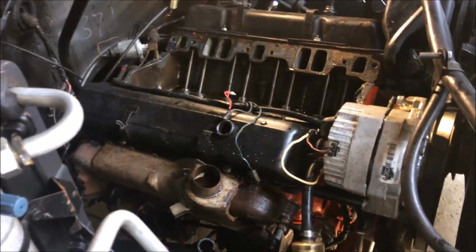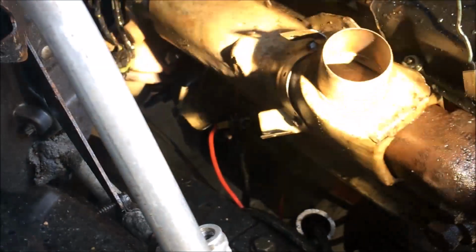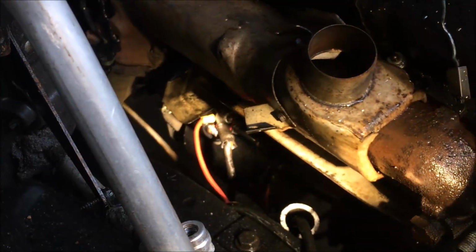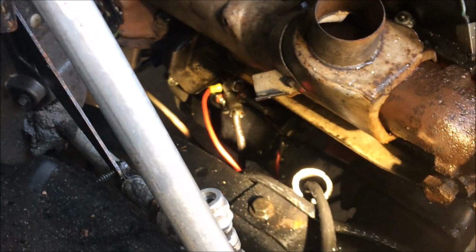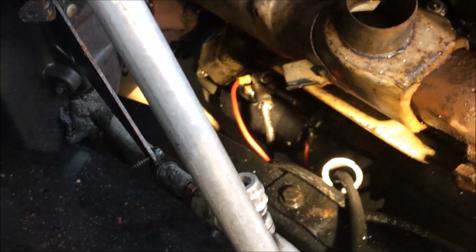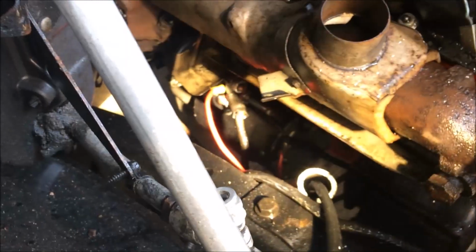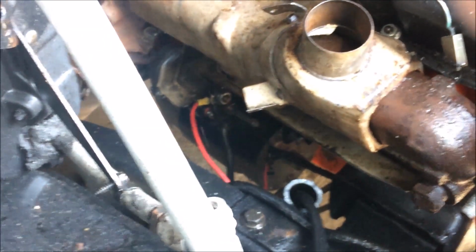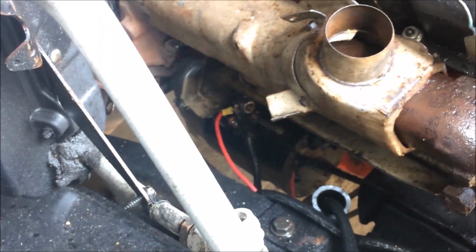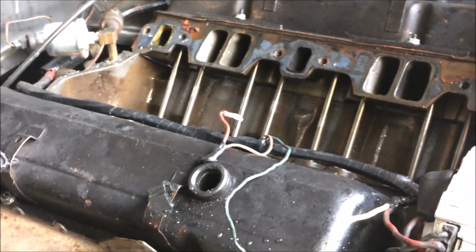And we got to get some wiring for our starter. You may be able to see it down in there. Need the light running. The starter, all the wiring screwed up, which is why it's eating starters. It's part of it. Look at that. I mean, come on, man. And they're electrical taping wires together. Your starter is going to eat up if the wiring's all screwed up, ain't it? Yep. And, you know, the grinding. Now, the grinding is either the starter has worn itself out, probably because the wiring's screwed up, or it's misadjusted. And they do move sometimes, so you got to get them in there just right. So we'll do a whole video on the starter one of these days. But first we got to do this top.